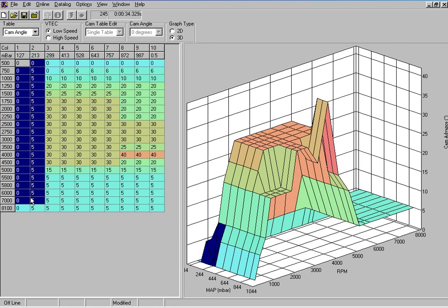Columns 1 and 2, where you have very high manifold vacuum, measured by millibar here, are the deceleration maps. They are when you're changing gear, you lift off the accelerator, the computer wants to put the cam angles at 0 or 5 degrees. That is, the cam lobe centers are separated. Valve overlap is minimal, very, very small, and there's very little contamination of intake fuel going into the exhaust system. Good for emissions, so keeping these cam angles small makes your car run very smoothly under deceleration.